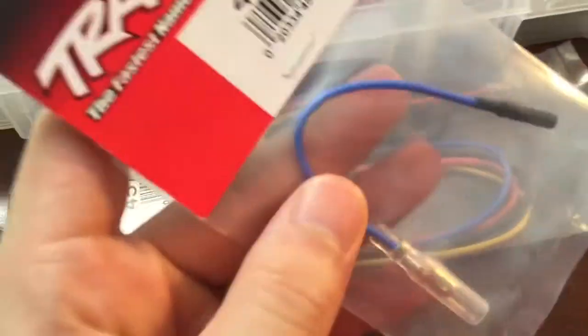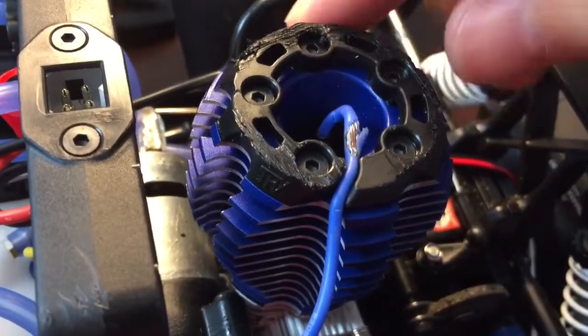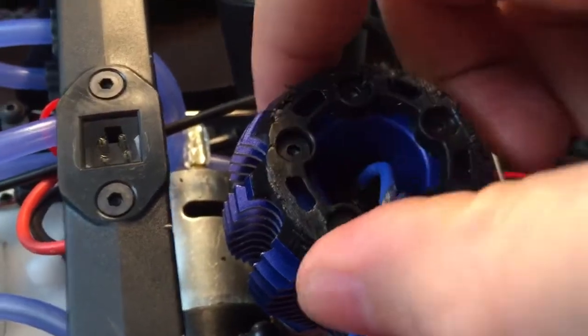Another thing I got from YouTube, some kid, I think RC Nitro Kid, he recommended getting new glow plug wires. They're really cheap. It's good to have these as backups, because after a while, if you're pulling this in and out a lot to put in after-run oil after you've run it, I had these scratches. I flipped it once while I was breaking in. But after you pull this in and out a few times, it wears away this heat shrink, especially if you use pliers with teeth. After a while, it just eats it. It still works fine, but something to think about.